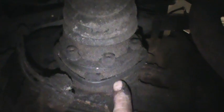Trying to figure out what this thing is — it's something aftermarket. This is the CV joint and there's a tie wrap on it. If you spin it, you can see there's like a weight or a magnet, and they have a sensor on here too. It's definitely aftermarket. My thinking is maybe the cruise control in it is an aftermarket unit and they used that for a speed sensor. It actually rubs — I think the tie wrap's gotten loose over time. I'll just rip it right off and get it out of there.